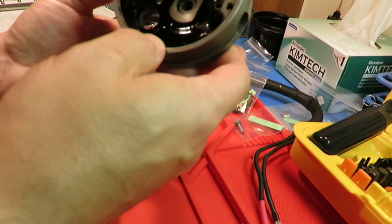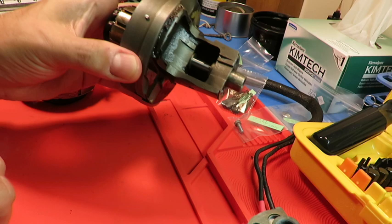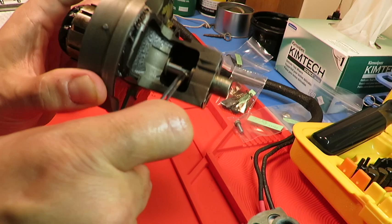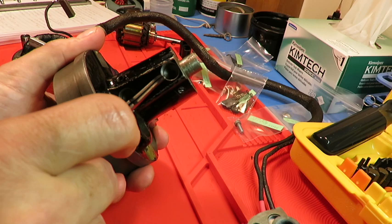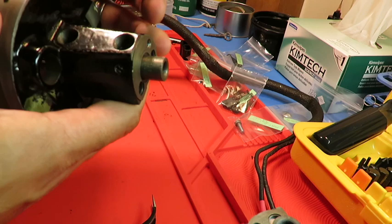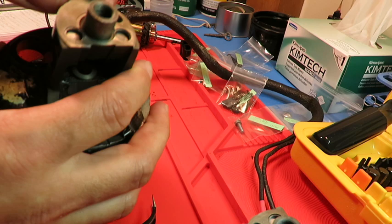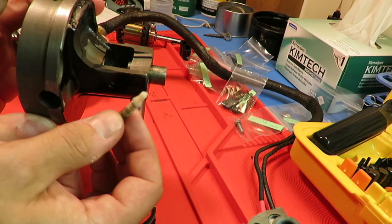The difference that's bothering me a little bit about these two motors is where the commutator shaft goes into the motor. There's a couple bushings that hold it, and you can see one sticking out here that goes through the housing. And then there's one in here as well, and the shaft spins within these bushings. And through the bushings are holes in the bottom through which go felt wicks on springs, which rest inside these cups that are full of grease. So the idea is that the felt wick is in there on a spring, resting in this cup full of grease as a reservoir, and the motor is like this in its native state. And as the motor heats up, the grease or motor lubricant melts slightly and is wicked up this wick into the bushing to lubricate the shaft as it turns.